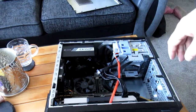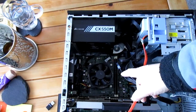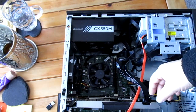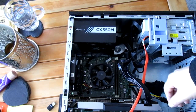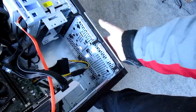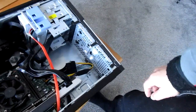Inside, we've still got the basic hockey puck cooler that comes standard with these. I took it off, put some thermal grizzly paste on after I'd cleaned it all, cleaned the fan up. To be honest, looking at the temps, even when it's running at 100%, plenty good enough. It's got the single exhaust fan here. You've got good airflow coming in through here as well, which you can feel when it's on. You could stick an extra fan there if you wanted to, but I haven't bothered.